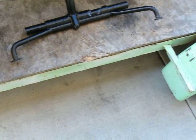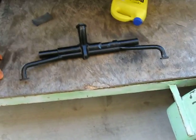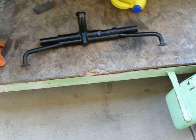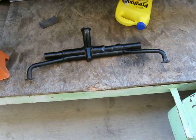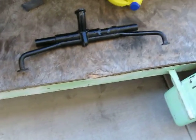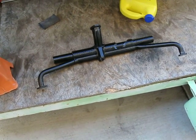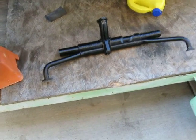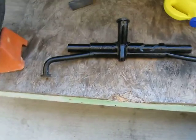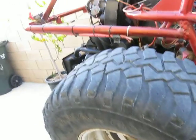I got this manifold for cheap — five bucks. I just cleared out the heat riser tubes and painted it up. I also heard that in California only, in '72 and '73, they used a 1600cc dual port with the 30 PICT carburetors — the smaller carburetor. If that's the case, then with the right size carburetor I can put it on that engine and be okay. I know they don't make adapters to put the bigger carburetor on the smaller manifolds.